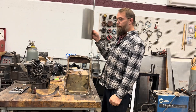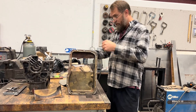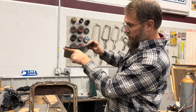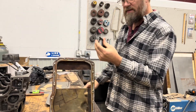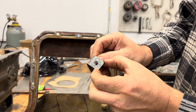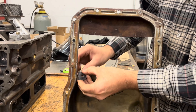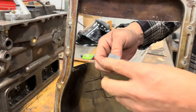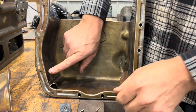I needed a way to actually bolt this into here, so I decided to come up with some tabs. I originally had that slid in there and came up with the angle by measuring it to the side of the pan and made up these clips. It's 14 gauge so it's a little heavier. I can weld these in the side and I'll probably bridge the seam here on this side and the other side, then put one down here and one over here.